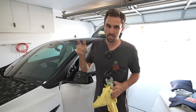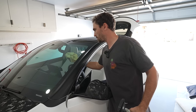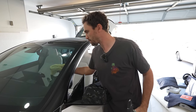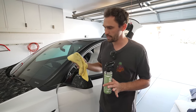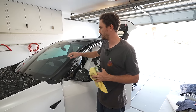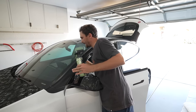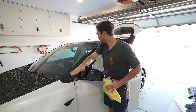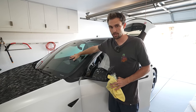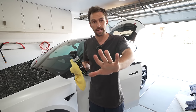A lot of people vape or smoke cigarettes, and the inside of your windshield actually gets a film layer on it. All you need to do — you don't even really need solution, just don't use Windex if you have tint since it has ammonia that can ruin tint — is take a microfiber and wipe down the interior of your windshield. It will give you better visibility when the sun is setting; that glare makes things unseeable if the inside is dirty.